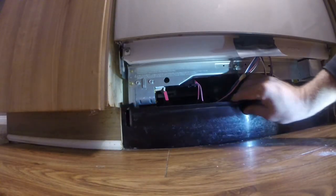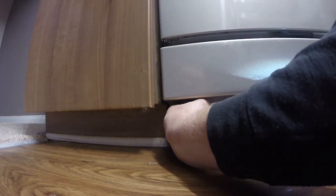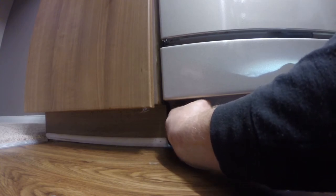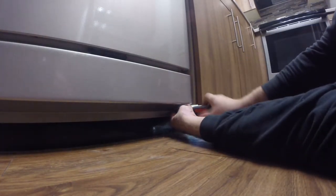We've got our bottom plate here. It's easy, just line up the holes and then set your top plate, just like that, and then you can slide it over. You line up your bottom holes and tighten them on. Insert the screws and tighten those down. That's adjusting the tension on the door. There are definitely a lot of different ways that dishwashers have that adjustment setting. There we go. Now we can tighten the top ones up just a little bit.